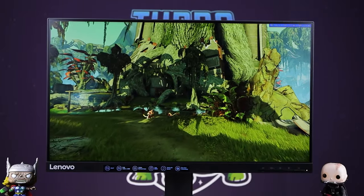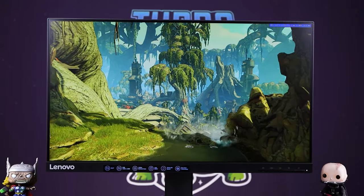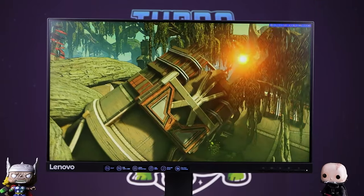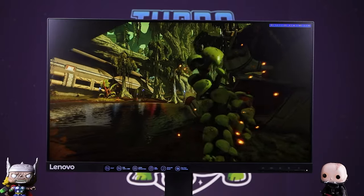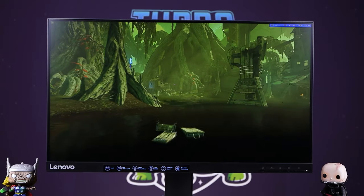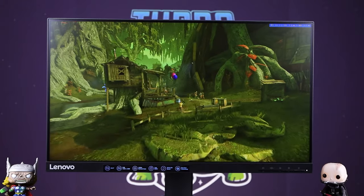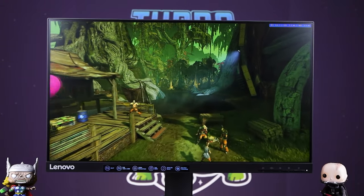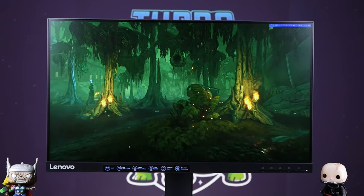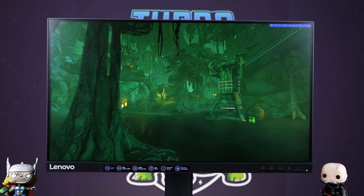The fact that you can set the saturation directly on the panel itself — it now has a 20% boost to its saturation — means it becomes much like a VA visually. It doesn't have quite as good a contrast ratio, which is just a default trade-off. The viewing angles are going to require you to be a little more dead-on; you probably get about 100 degrees of comfortable viewing angle before that TN sheen kicks in. IPS is kind of the pinnacle of the technology, but it has its own issues with IPS glow. I like what they've done — it was a very clever and sneaky way to jump into the monitor market, which is extremely competitive, especially here in South Africa.